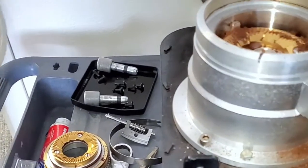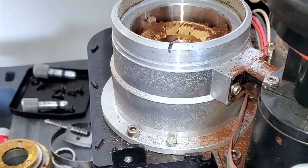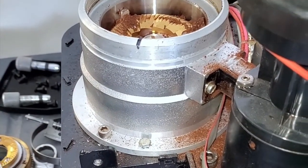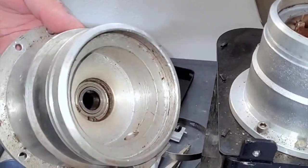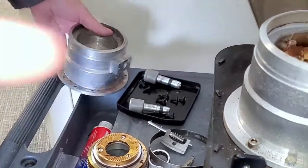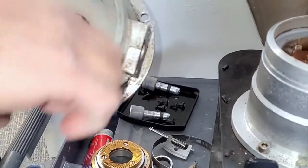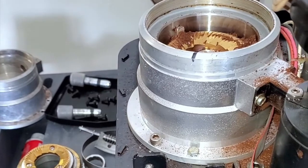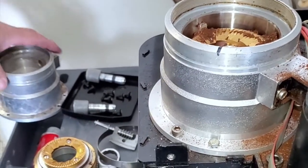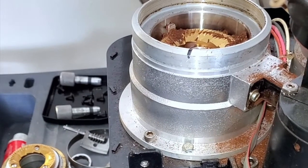So this grinder doesn't need to be upgraded — that's cool. With the ceramic burrs, if something gets into them they can chip and it just gouges the walls. There's a way of updating that — you can buy just this piece from La Marzocco. They sell just this piece that will have the stainless steel wall on it. Of course you have to take the whole grinder motor out and take it apart, which is going to be costly, but it's cost effective. A new grinder is fifty-eight hundred dollars; to do this is about a thousand.